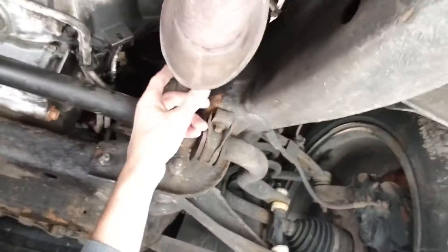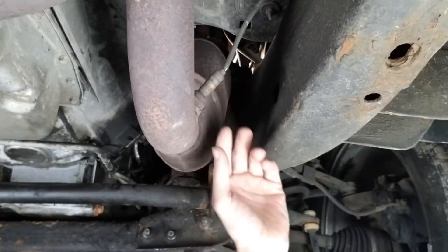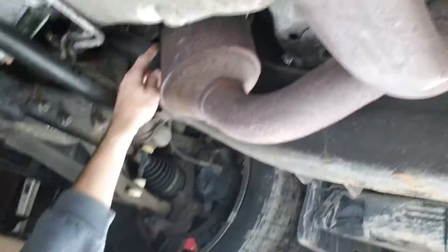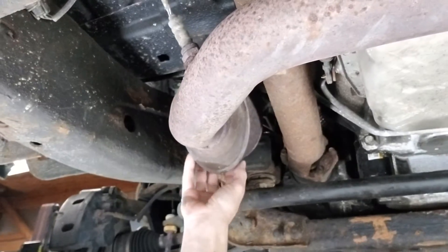Welcome to my pit. Right up here you can see the collectors. This one here is the second bank O2 sensor, and we do have the bank one sensor out, which made it a lot easier. We need to put the starter back in, get it lined up, come back over here to the collector and bolt it all up. We'll have everything back up and running today.